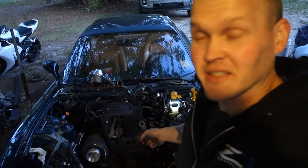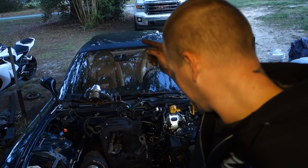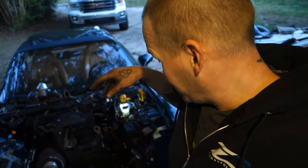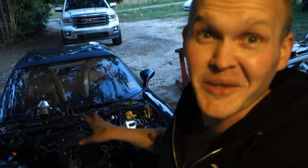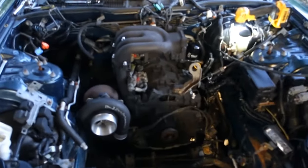Your boy's stress level is up. I'm telling you, this thing's driving me dang crazy. We got this ticking time bomb in this turd muffin and it was a nightmare. The wastegate was hitting - they should have known better putting the turbo on like that. The turbo was hitting on the heater core line and hitting on the frame and everything. Hitting on everything. But it's in here, just in time for it to get dark.